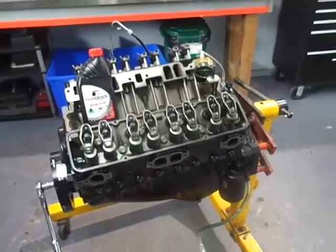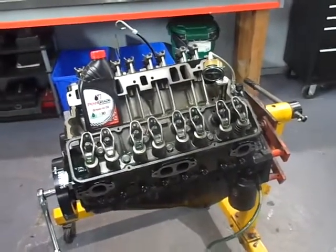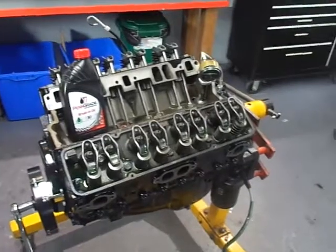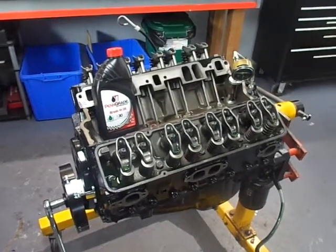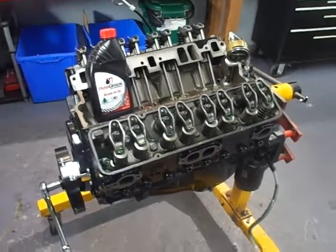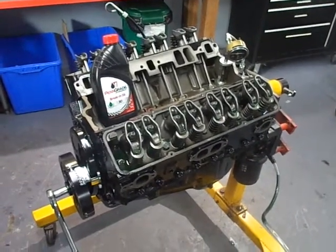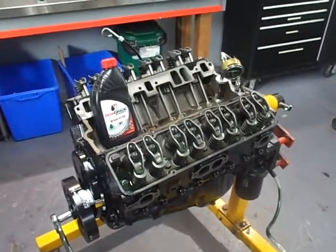When the lifters were reinstalled I coated the bottom of the lifters again and reset the valves. While the lifters were out I also took a lifter and put it in every lifter bore and rotated it with my fingers, because if the lifter can't rotate the camshaft is going to burn up in no time. The lifters must be able to rotate freely or they will wear out the camshaft — and that checked out okay.